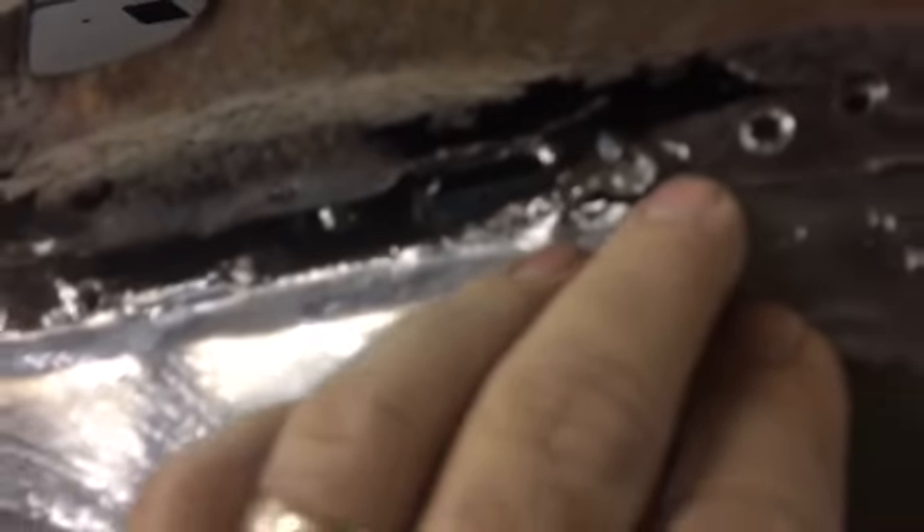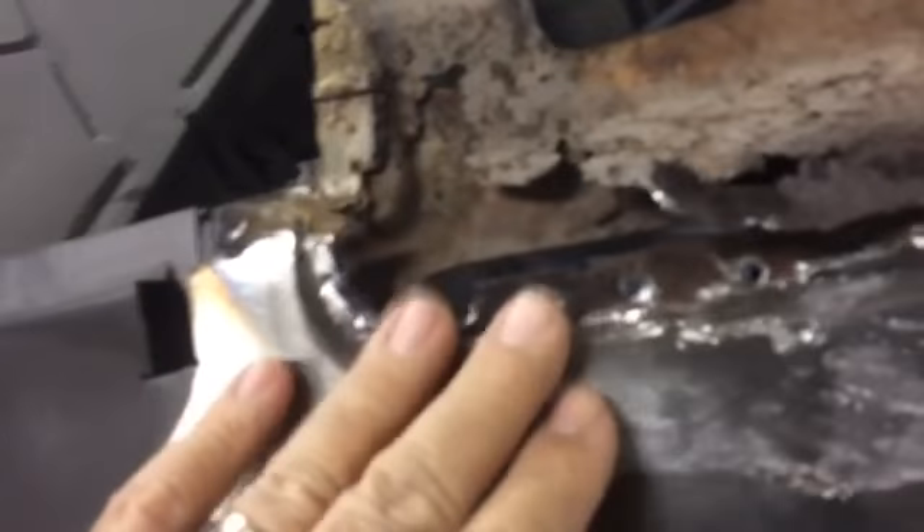I'll tell you, we've got a mess. The quarter panel goes up under everything. The inner roof panel laps down over the quarter, and then the roof skin comes down and comes in this channel — that's what's leaded over. Everything's leaded over. We've got rust all the way up to where the door window starts right here. All this is pretty good, but we've got rust here.